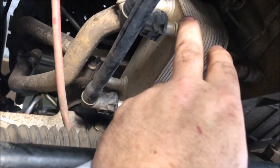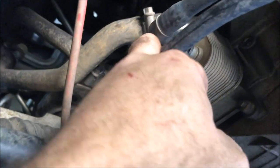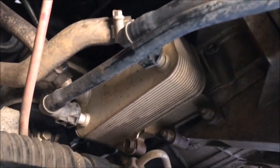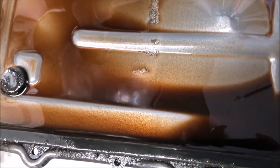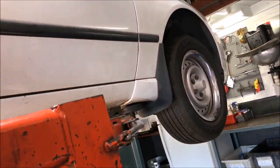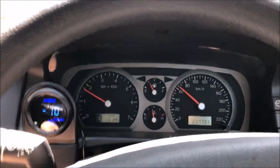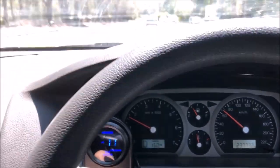That's an original factory transmission cooler — absolutely good for nothing. It's cooled by the engine coolant, so if your engine's hot, your transmission's going to be hot. So basically we're running an independent air-cooled transmission cooler at the front. The kit didn't arrive, so that'll happen another day. With these transmissions, apparently the best thing is to keep them cool and you'll get a better life out of them. Pans off — a little bit of metal here, magnet's got a bit of stuff on it which is pretty normal. That big ding is going up into the filter, so whatever hit it hit hard. But we're replacing all that. I don't have a lot of faith in this transmission with turbos — they don't have a good rep standard. I do have a spare if I need it.